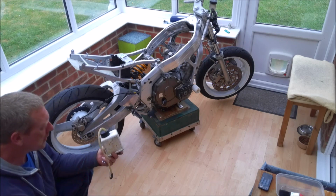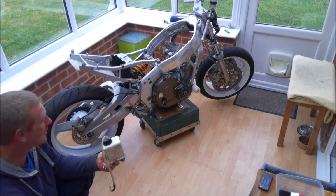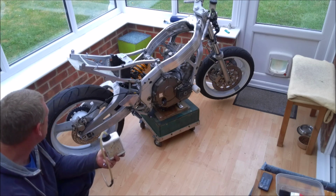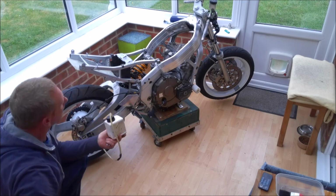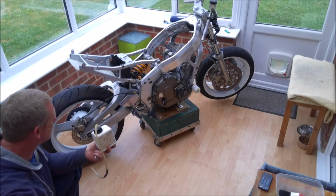But yeah, normally when people do have problems with it, it's generally a sign that there's something wrong with your brake system, either the master cylinder being a bit worn, or something wrong with the calipers. Could even be that people haven't fully tightened up the banjo bolts and you've got an air leak. You'll soon see that though, because the fluid will find its way out at every opportunity.